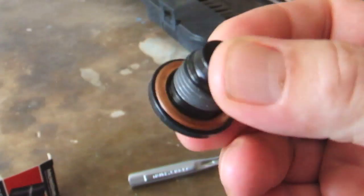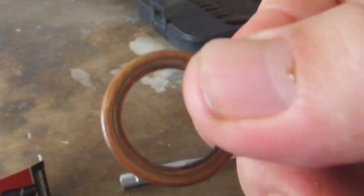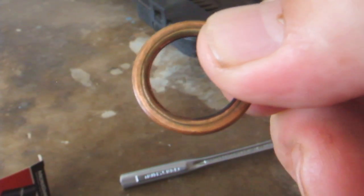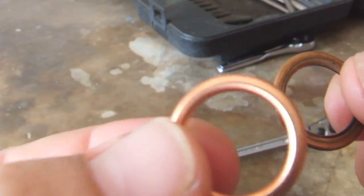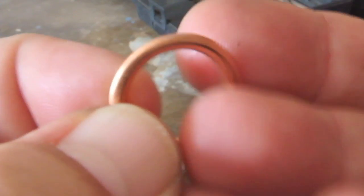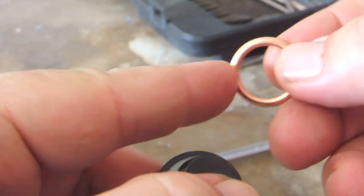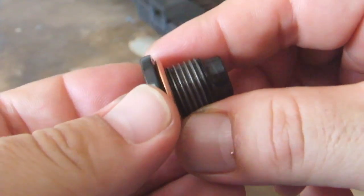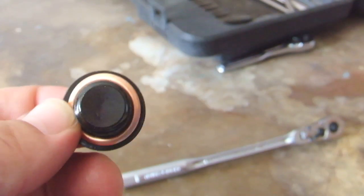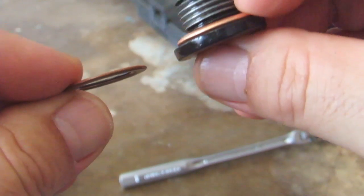At this point I'm taking off the copper crush washer, and I noticed that it has a seam on one side. The OEM washer had the same seam. I put the seam on the same side as factory — that is towards the head of the plug. I doubt it makes a difference; I think the important point is to replace the washer. If it was a flat steel washer, I wouldn't worry about changing it, but because it is a copper crush washer, I think it's cheap insurance. You can see the difference in thickness between the old washer and the new washer.